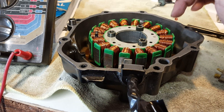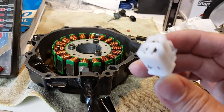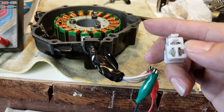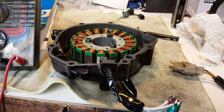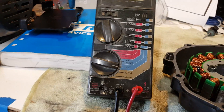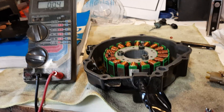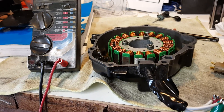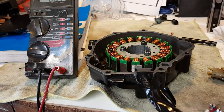To test your stator while it's on the bike and running, you simply disconnect the stator plug while the bike is running and cold, stick your test leads in there, rev the bike up, and at 5,000 RPMs you should be seeing around 65 volts AC on your meter. One important thing — so you don't fry your meter — make sure you set it to AC voltage, not DC, or you will burn it out. If you're not seeing that 65 volts and you're seeing something less, more is okay but less is not good. If you're seeing less, chances are your stator is bad.